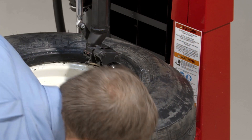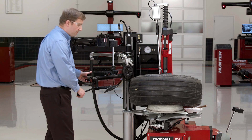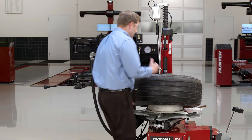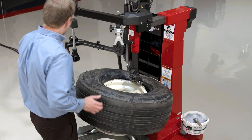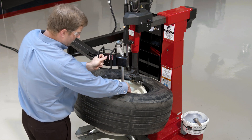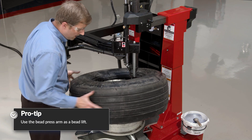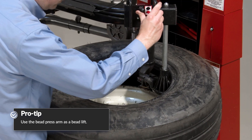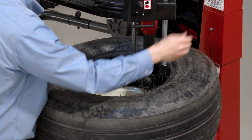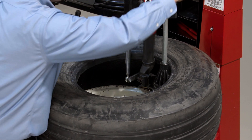Now, one of the things that will sometimes happen is the bottom bead will reseat. We can re-break that bottom bead at any point with this lower disc — that's a technique that works on any tire. In this case it was able to break free. Now I'm actually going to use the demount hook to demount the lower bead on this assembly. So I'm going to use my bead press as a bead lift. There we go — that got it hooked.